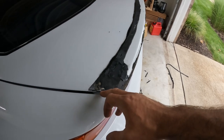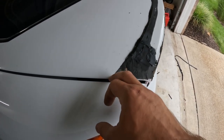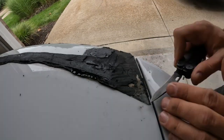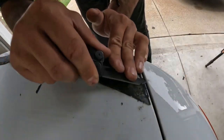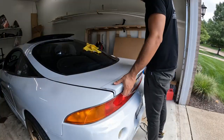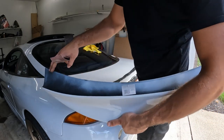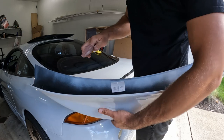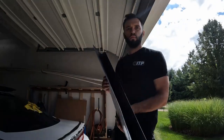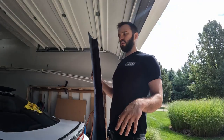The new wing is a little thinner than the old one, so I've got to clean up this black glue a little bit on the edges here so you can't see it underneath the wing — same thing on this side. Now I'm going to sand up the inside of this wing to give it something for the glue to stick to. Once that's done, I'll wipe it down with alcohol and wipe the inside with alcohol, and then we'll apply the glue to the wing.